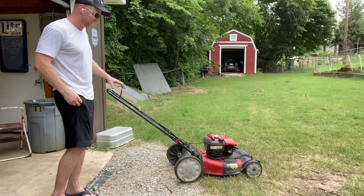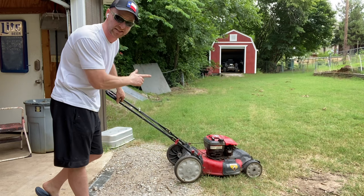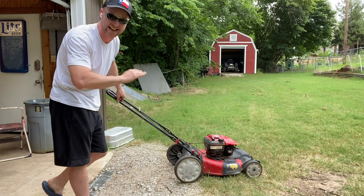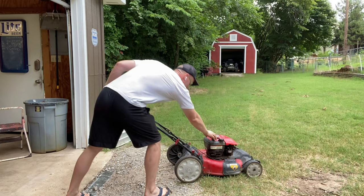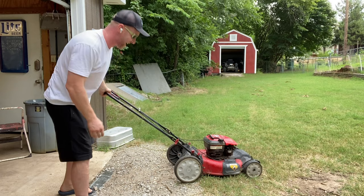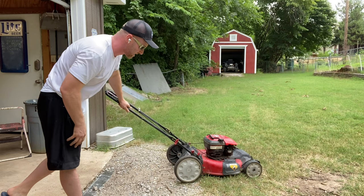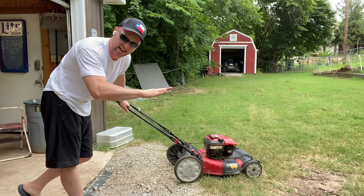We're gonna give her a whirl. This thing literally hasn't run in five years — I'm pretty excited. I have not started this thing yet, it has not run yet. All we've done is put fresh gas in it, cleaned out that carb jet, and that's it. We didn't even take the carb off the motor. So let's see if she starts up. Did you hear that? The mower is freaking awesome — look at that! So that proves it: simple carb, just clean that jet out and you should be good to go. I'm going to have another video on doing the whole thing — the oil, the blade, the air filter, and the spark plug. But if you just want something quick to knock that grass down and get you rolling, that's it. Hope that helps some people — please subscribe. Mower Mike out.